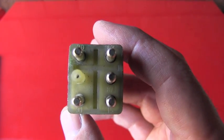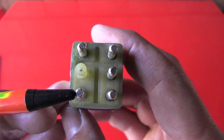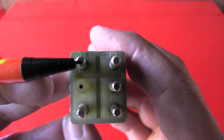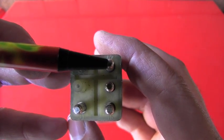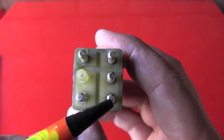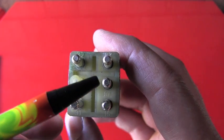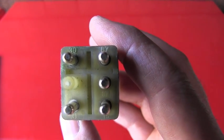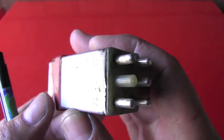I took it to the car close to the battery, then I put the negative on the 31 and the positive jumper wire to the 30. I checked that I had no voltage on the outputs. Then I brought another positive lead from the battery and touched terminal number 15. I immediately heard an audible click and the relay was providing battery voltage out of both 87s. So this relay actually works perfectly — there is nothing wrong with it.